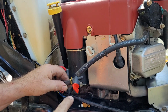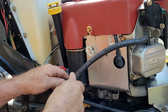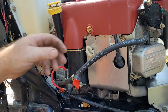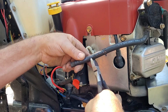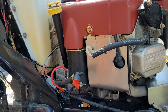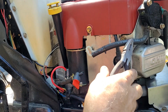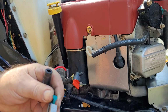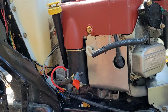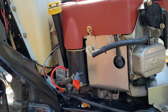And when you put these, put those up out of the way. Maybe not in the back, but up out of the way, so when you turn it with your hand, you don't gnarl your finger as you roll it. That's good hose yet. I'm going to leave it because it's got that built-in 90. No need to change it if it's still good. It's kind of nice to have a built-in 90 where one's required because it keeps it away from blocking access to the valve cover if you need it.